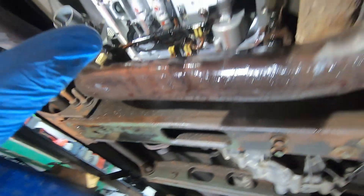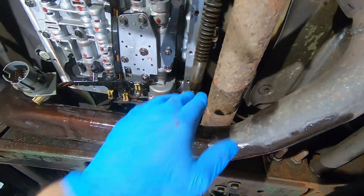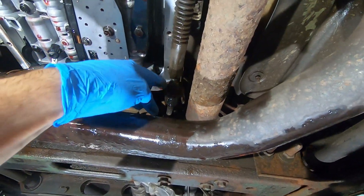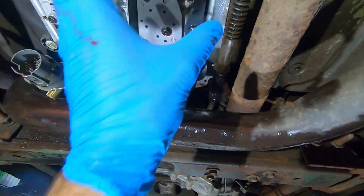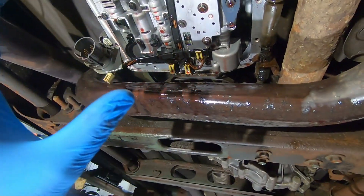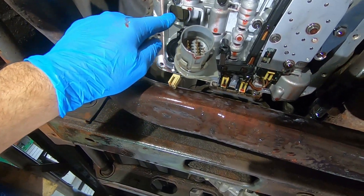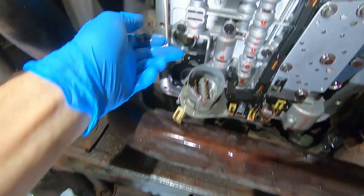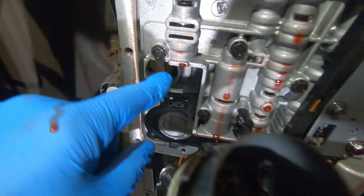To get this off was a bit of a nuisance. I had to take the transmission pan bolts out, bend the bracket that holds the shift cable toward the driver's side to get it out of the way, then drop the pan down — trying not to make too much of a mess on the floor. Once the pan was out of the way, I could get access to the connector.